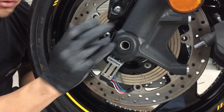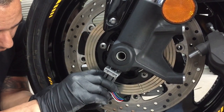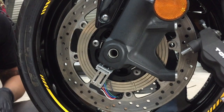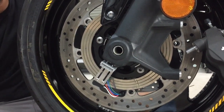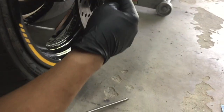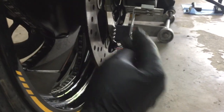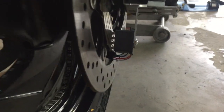I needed to bring this bracket down in order for us to have some type of adjustment on the placement of this brush block. Now, if you come over here, come around this side, you'll notice where the brushes are all lined up, and they're pushed in about 50% in. These are spring-loaded brush blocks.